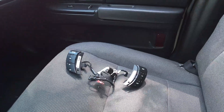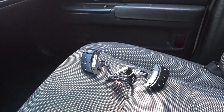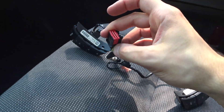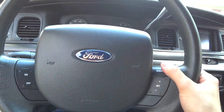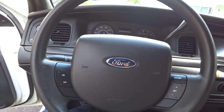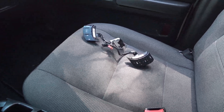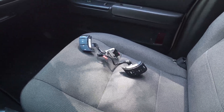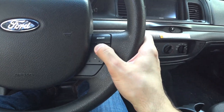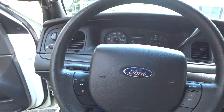So I just want to be able to turn it down as I slow down and turn it up as I drive faster. This video is going to show you how to do this. I'll leave the part numbers in the video description. You can get these brand new from Ford — they're about $50 a piece for each half — and you also need the appropriate wiring harness. This retrofit can be done on any Panther platform car. These buttons came from a higher trim, like the very high trim Crown Victoria, the high trim Mercury Grand Marquis, and also the Lincoln Town Car. As long as you have cruise control, you really only need these three components and it should be a direct plug-and-play.